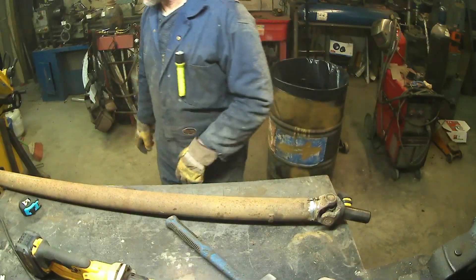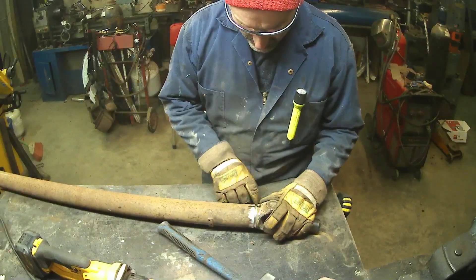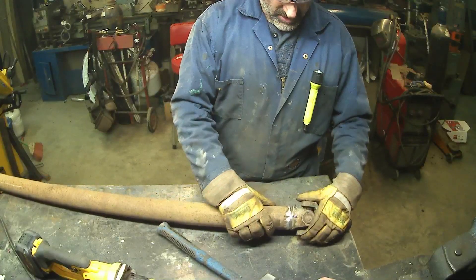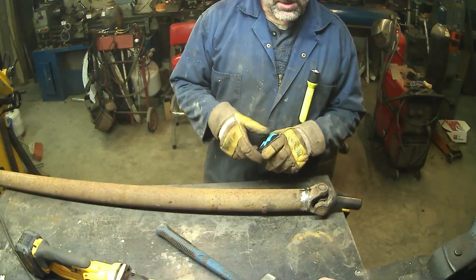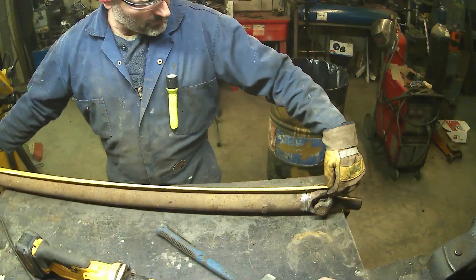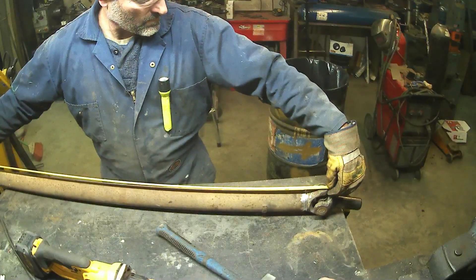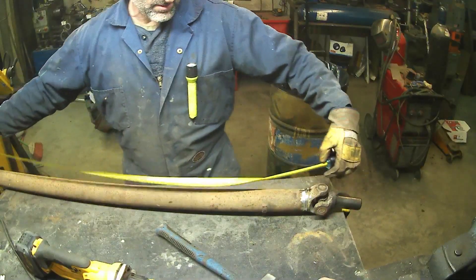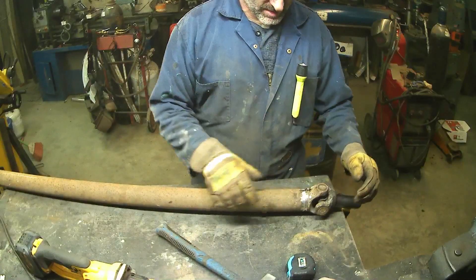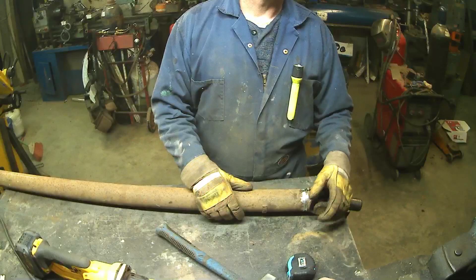You can see I'm sort of in. You can see when the pieces are in, there's plenty of room to weld and lots of room for adjustability yet. I've got 52 and 3 quarter, which is what I need on the truck. Now I'm going to get my U-joint and then I'm going to set this up so I can align it on the truck.